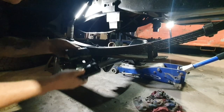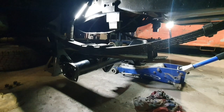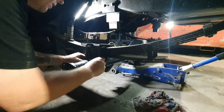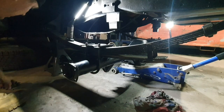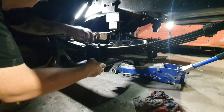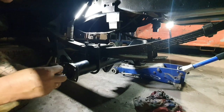Let's put some U-bolts on her. I've got my U-bolts ready — they come up and in, just squeeze them together a bit. I've got nuts and washers; just reusing the factory hardware here, and it was all in really good nick. It's not a four-wheel drive, so everything was good.